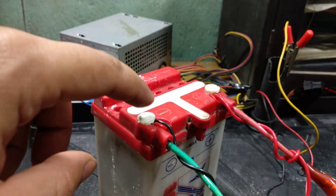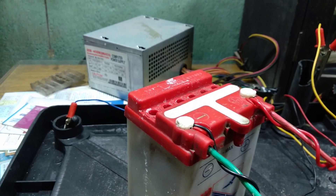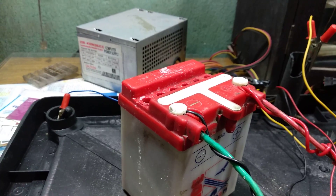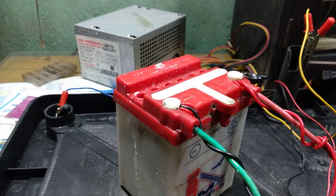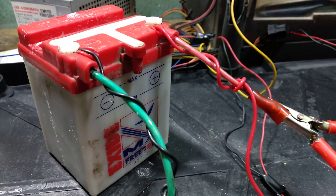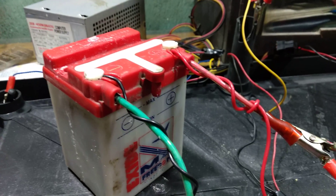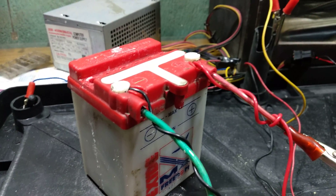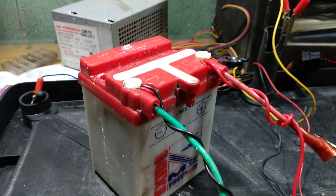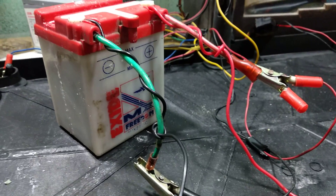What I did was I opened the two connector caps — I removed them using a knife. What I saw was they were not clean, so I resoldered the points and added external wires to them. After that I tried to charge again; initially it was charging but not properly. After I cut and resoldered the wire, now it is charging properly.